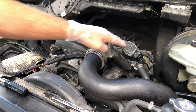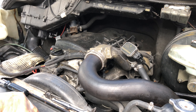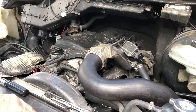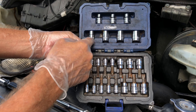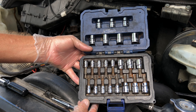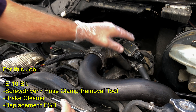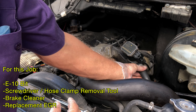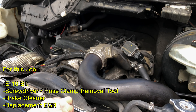Based on those codes from the iCarSoft, today we're going to replace the EGR valve. About all the tools you'll need for a Sprinter are in one little box — E-sockets and Torx bits, a good variety for just about everything Sprinter-related, at least on the T1N. The EGR on the 2004 through 2006 is water-cooled, a little different from the older 2002–2003 models.